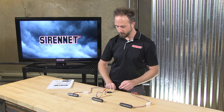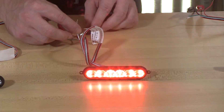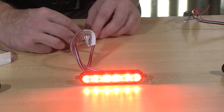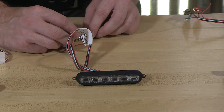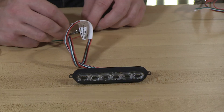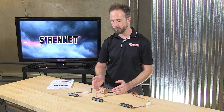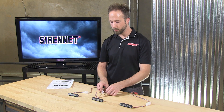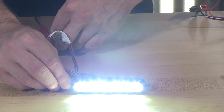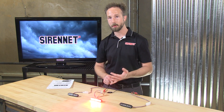Switching over to the center, this is our tricolor variant — red, blue, and white. Adjusting flash patterns is easy to do: grab the white wire, momentarily apply it to a ground source, and that makes a pattern adjustment. You can do this during initial installation, or add a momentary switch for pattern change on the fly. When you activate the secondary mode wire with positive 12 volts, it overrides to steady burn white, allowing you to activate scene lighting on the interior or exterior of your vehicle.